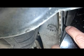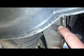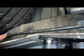Here's my socket underneath next to my towbar. What I actually did was I drilled a little hole in the grommet and came in through the box section, then came all along this box section and out through this grommet, then into the next grommet here to keep all the wire hidden, and then it went up into the van.